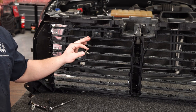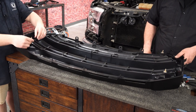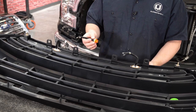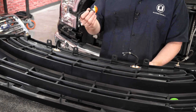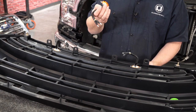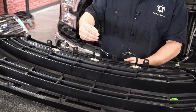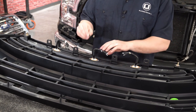We're almost ready to install the Roush grille onto our shutter assembly and get it back onto the truck. We're going to reinstall the studs with those plastic pieces in — there are four, two on the outer edge — and basically these are just going to slot into the Roush grille, give them a good push and they'll clip right into place. The next step is to install the included LED lights. These are a really sleek, well-made light — Grote makes a ton of lighting equipment for factory Raptors and many other vehicles. Make sure the logo and the SAE signature is facing the proper way, push them down, and then inside your hardware bag are these really tiny black locking washers that go onto those little studs to keep them secure.